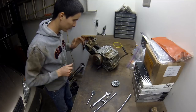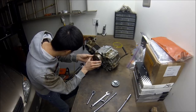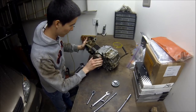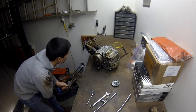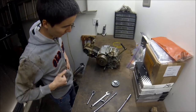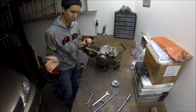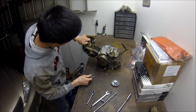There are two timing marks on the flywheel — there's an F and a T. F is where it's supposed to fire if you're using a timing light, and T is where you should have all your timing marks lined up. The timing is correct. So next thing we'll look at is valve clearances — see if the valves are just hanging open. If that's not it then chances are we've got a bent valve. Valve clearances on these engines are checked cold, and there are tappets underneath this cover.